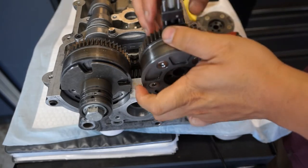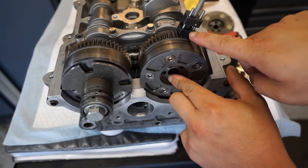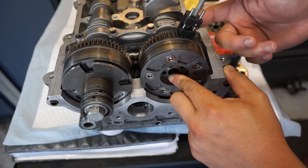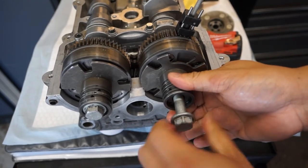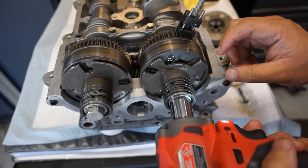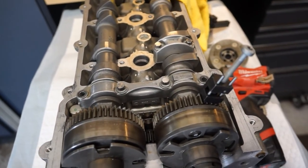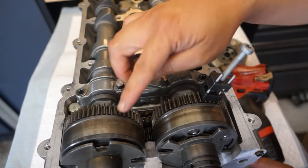Washers in, putting this back into its home place. The part number matches where the timing tool for the lash gear is — that way for the next person or for future work it's easy to access. Grab one of the sprockets and install it as well. Start it out and buzz it in — still spinning freely, perfect. I've added a couple of bolts on the cams to hold things down. The narrower teeth are now left-adjusted compared to the wider teeth.